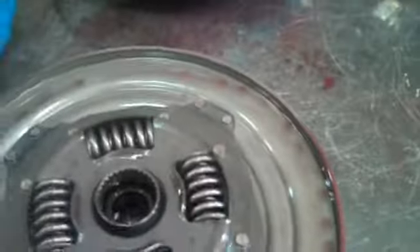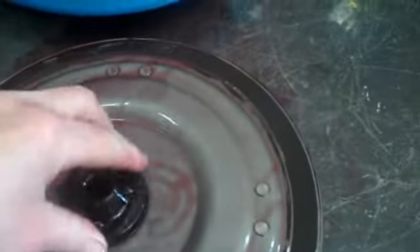I also checked this O-ring on this adapter right here. Sorry about the terrible video, but the O-ring is not flat — it's good, it's not cut, it's there. The piston is flat, no cracks around the rivets. Nothing that I could see that would cause a no-lockup condition.